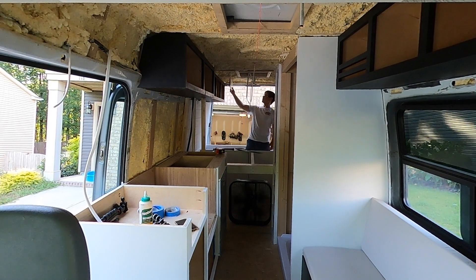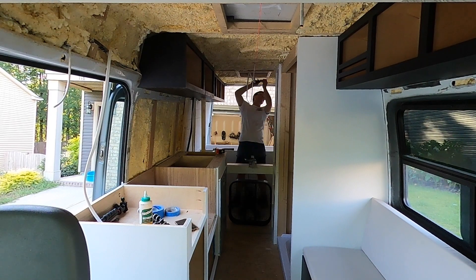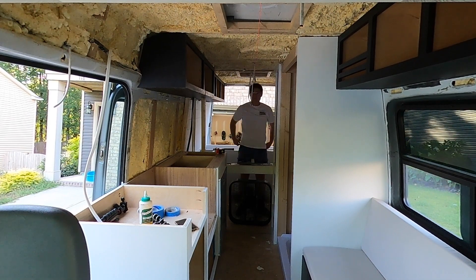In the time-lapse footage, what I'm working on right here is cutting out the hole in the back framing for our backup camera wire that runs all the way to the front of the van. I had to chisel a little bit out and make sure that the ceiling shiplap could go onto the frame without pinching the wire.